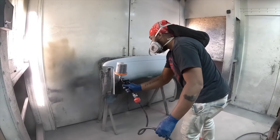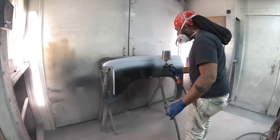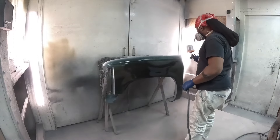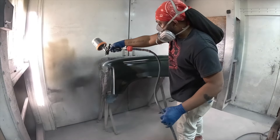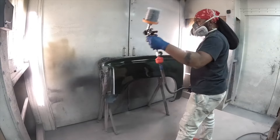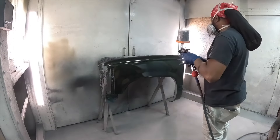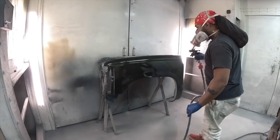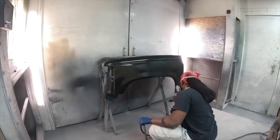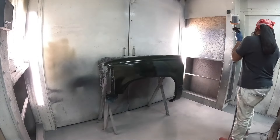It came off real peely. That pressure was way too low for this spray gun. This spray gun is definitely the opposite of the PHS 155 — it just ain't the same spray gun. Let me just tell you that right off the bat. I was not happy with how peely of a paint I was getting out of the spray gun. You see me looking at it, trying to decide if I want to spray even more. Definitely wasn't happy with that first coat.